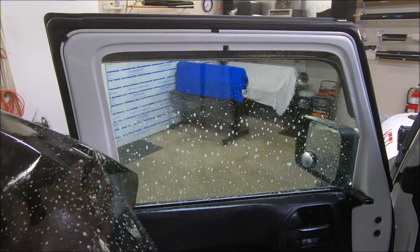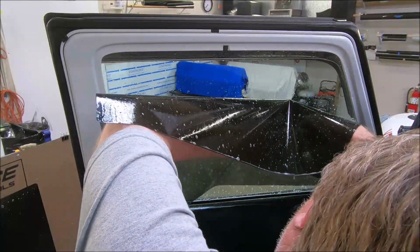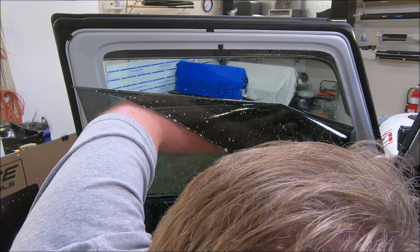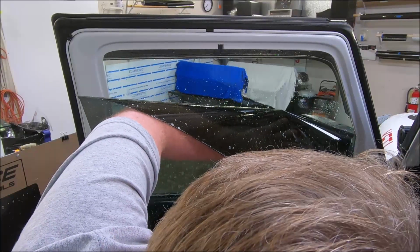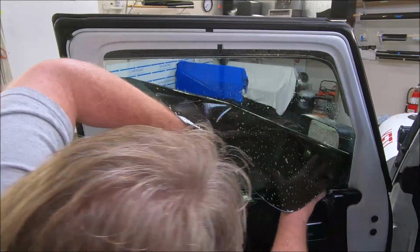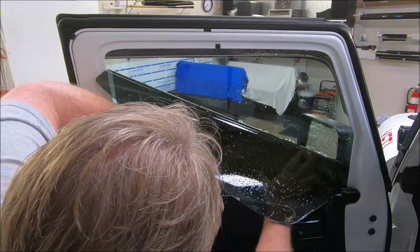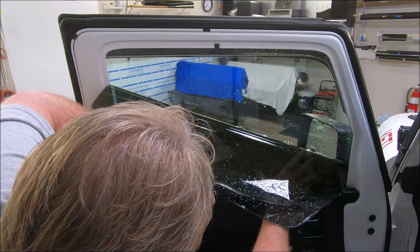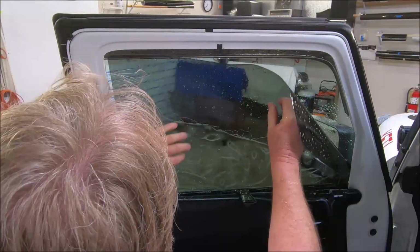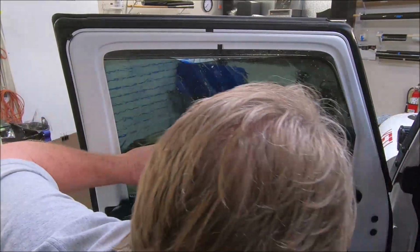Now, I'm gonna bring this film in, floating on the back of my arms. I go right over here to the short side. Now I'm careful to hold this film so we're not touching anything on the back side or over here. I'm just gonna drop this film right down in the seal, push out on the window, and you see it's just falling right behind the lower rub rail. It drops right off in. I bring it over to the back side, put that on the glass.